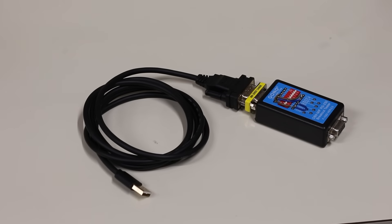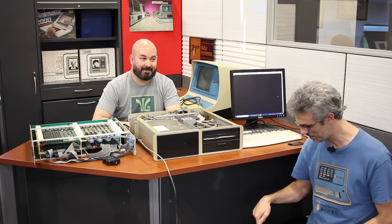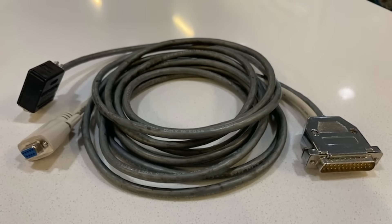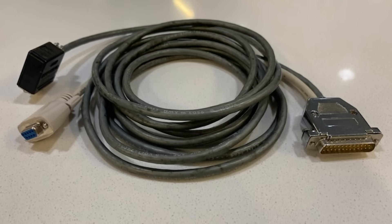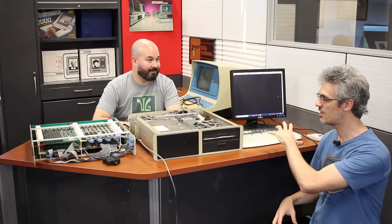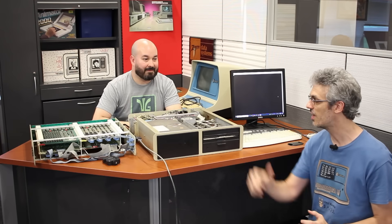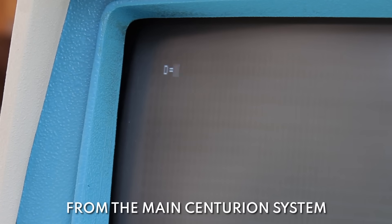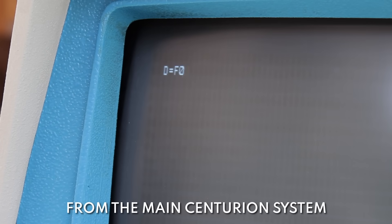The terminal tripped us up because it has a bad power supply — I think we might be able to get that repaired tomorrow. So we aren't stuck doing nothing today, we tried to get another terminal going, but I in my infinite wisdom left my RS-232 to USB cable at home, so that was the fallback plan gone. Thankfully Aaron had a Windows 10 machine with a serial port on it, so we can use that with TeraTerm — except it's a DE9 serial port versus the DB25 that my cable is supposed to go to. So I did some quick hackery out of a spare DE9 cable, wired it up, and now we've got the Windows 10 machine up on TeraTerm. The Finch drive is unplugged so it won't spin up — all we're looking for is a D-equals prompt, which tells us the CPU is working, the memory is working, the mux card is working, and it's ready to go.